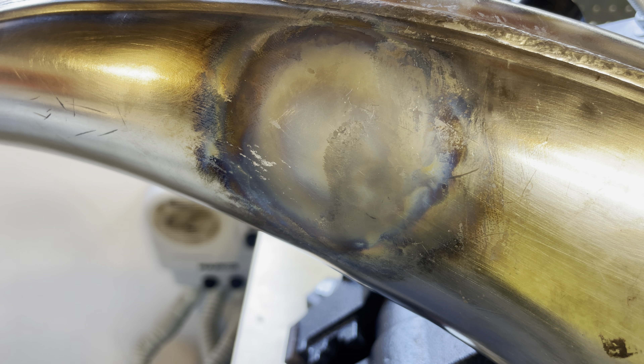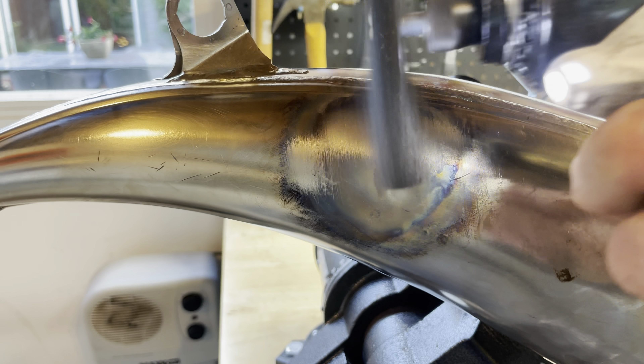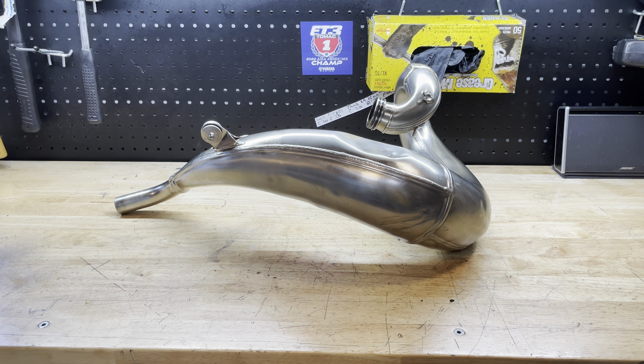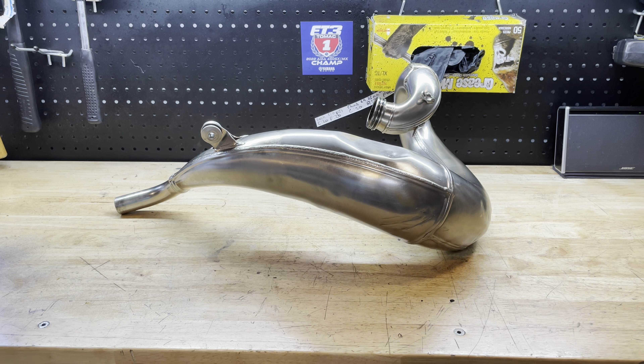That's done. I've released the air pressure. I'd say that's almost perfect — maybe 98% of the way. Now you're saying, what about that ugly mark? That looks bad — I'd rather have a dent. That's where this comes in. With safety glasses back on, there you have it. The heat got rid of that small notchy dent. I guess it was somewhere around here. Obviously these weren't the biggest dents.